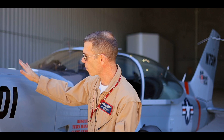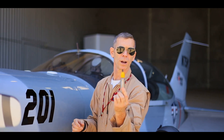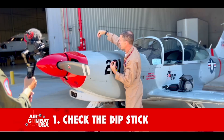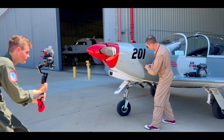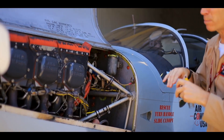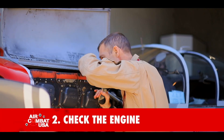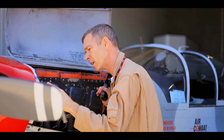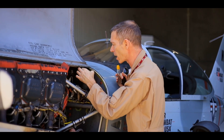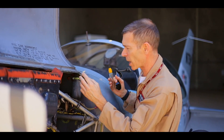Walking up to the Marchetti, the first place I go is the forward left cowling. I use my trusty fuel tester which has got a reversible screwdriver on it. We pull this out and take a close look at the dipstick. What's in here is of course the Lycoming O-540 engine — a horizontally opposed six-cylinder, 540 cubic inches. We're looking for the condition of the engine, making sure there's no leaks, everything's secure and tight. This is also where the brake fluid is — open it a quarter turn to the left and check it's at least three-quarters full with 5606 hydraulic fluid.